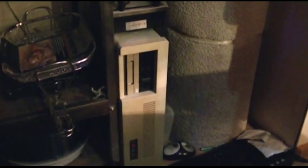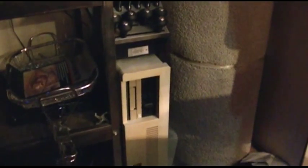Before I do that, I just want to explain a couple things here. This does have a tape backup drive. I've never used it. I believe it did come with a hard drive in it, but that hard drive was toast, unfortunately, and could not be revived even after I opened it and tried to make it work again. So all I'm left with is a 5 1/4 inch floppy, 360K double-sided. There's not really a lot you could fit in there, especially when you insist upon running the latest operating system that was available really for this, which was MS-DOS 6.22, which is exactly what I'm running.